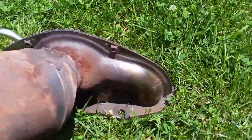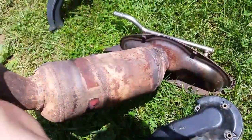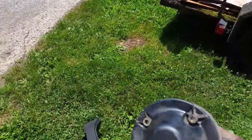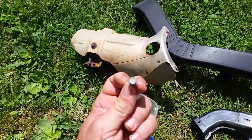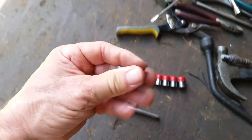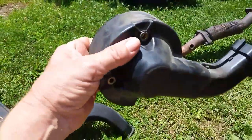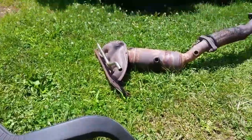This piece kind of sits like this, so you have to take it off the alternator to get to that bolt. These two lower bolts were easy to get off. This top one I had to stick my hand up in there and use a little tiny ratchet. These are little 7mm bolts you have to take out — once you get your hand up and break it loose, you can take it out with your fingers. When you pull it off the back of the alternator, you've got to wiggle it a little bit and slide it out between the manifold. Once you do, it'll pop out and you can get it out of the way, then take the rest of the bolts out.